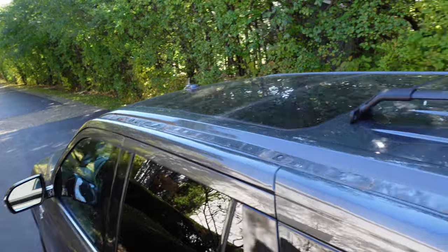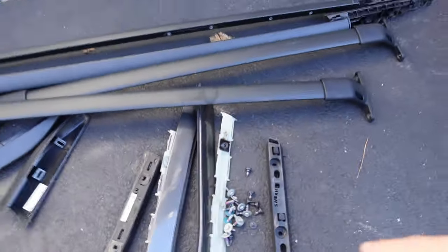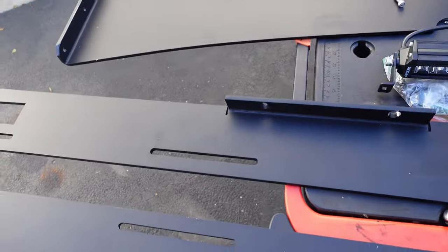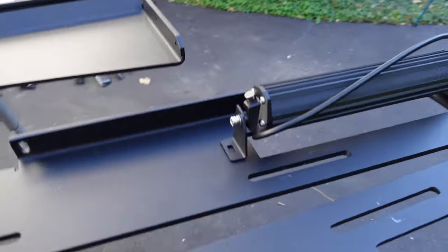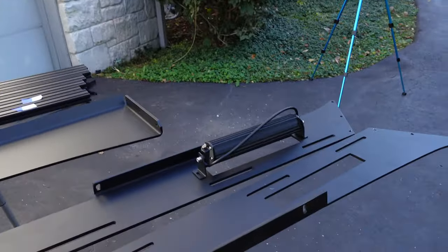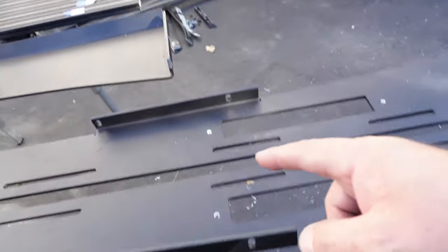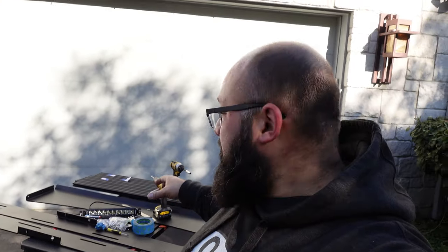Now that that's all removed, let me show you everything that came off — quite a bit actually, about 20 bolts and all those pieces. Since the roof rack comes with holes for the 10-inch lights but not the mounting spots — because every light is different — I'm going to drill these holes right now so I don't have to do it when it's on the car. I'll just mark the holes on all these mounts and pre-drill them so installing the lights is much easier on top of the car. Now that all four are pre-drilled, be sure you subscribe because the light installation will be in the next video.